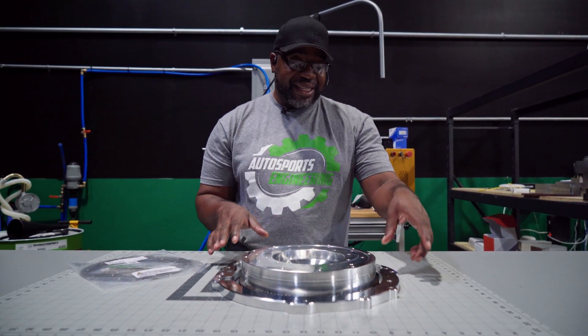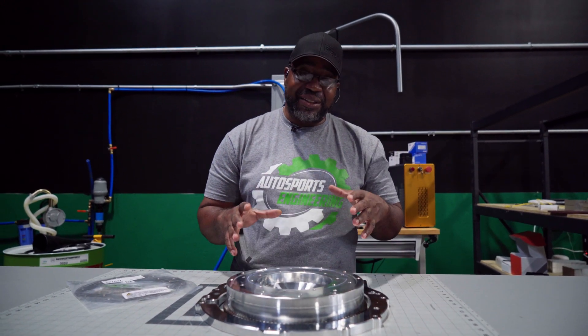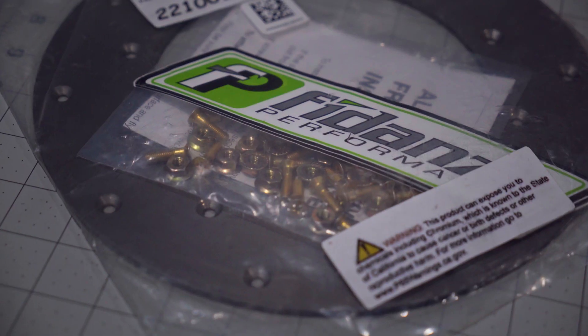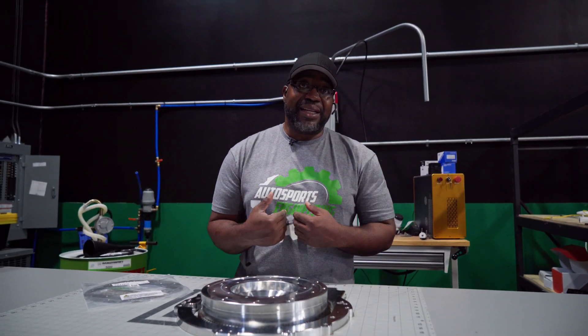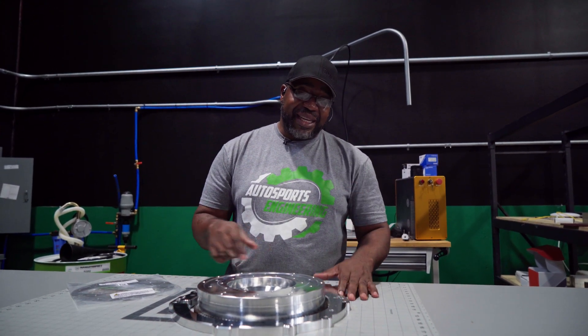It's plenty rigid. It integrates and works with the dowel pins, so the precision and location is centralized. The flywheels are a total weight of maybe about 15-16 pounds fully assembled. You use Fidanza replaceable friction surfaces, so as you wear them down you don't have to worry about coming directly back to me to get those. These are replaceable. It's a great kit.